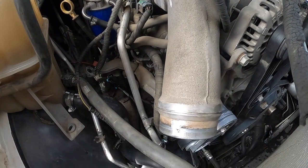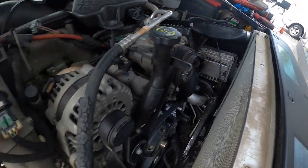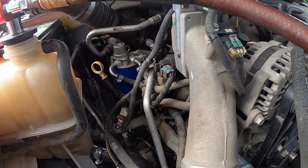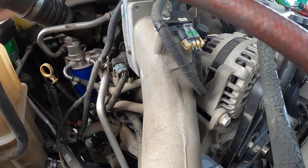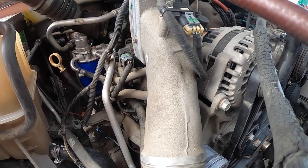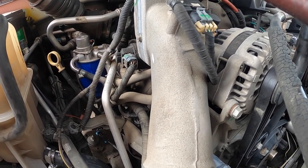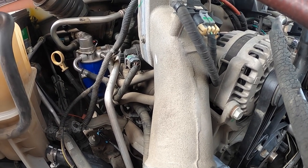The hoses, they started to get sucked down. They started to get smashed. Yeah, he's gonna come back for, we're gonna do heater hoses. There's another cooler hose for the EGR cooler we're gonna replace. And then I'm gonna get a thermostat housing for him too. Someone already broke it. I just don't wanna take it apart and then take it apart again next time. So I figured we'll do it in one shot and be done with it.